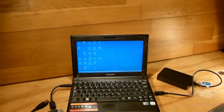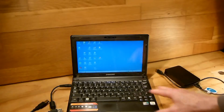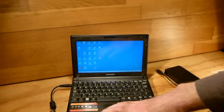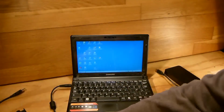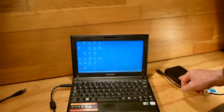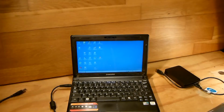So the 2 most important things to do when you get a laptop or a desktop or a netbook is make a systems image, put it on an external hard drive, then start making backups every week or every day, whichever suits you best, and also make a systems repair disk. Alright, and keep them safe, in a safe if possible. Waterproof safe is best, so that if anything ever happens, you'll always have that. Countless times these systems images have saved me, and then you just apply it onto the drive, and hey presto, you have your exact same system back up again.